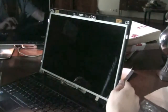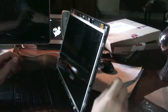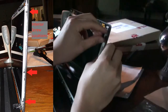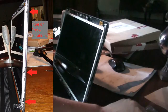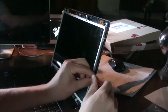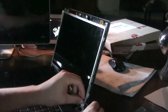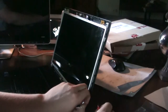Here, if we look on the side of the laptop screen, there are actually three screws holding the actual screen in place to the back of the laptop. We have to take these screws out. There are three on each side — one at the very top — and they're little black screws that are fairly easy to lose if you don't keep track of them, so you've got to put them in your bag immediately.